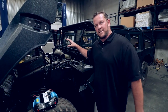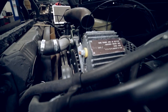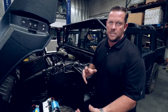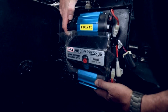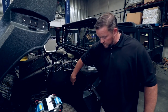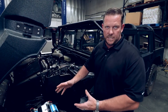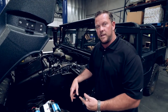Now that we have the hood open, you can really see that 6.2 tucked away in there — a far cry from what you've been used to seeing with a Duramax swap, but this engine is tried and true. It almost doesn't make enough power to hurt itself, so it just goes and goes. We've got a full CTIS system planned — changing out the spindles to CTIS-equipped style and going with an ARB 24-volt compressor. All the hosing and electrical will be plumbed into a manifold with a switch inside to control inflate and deflate for his beach and scuba application.